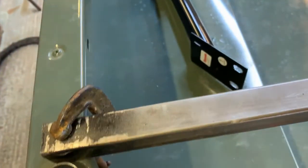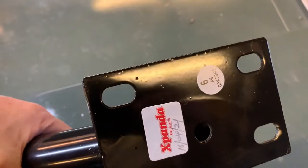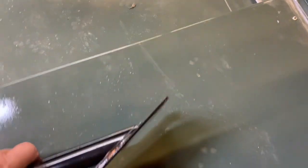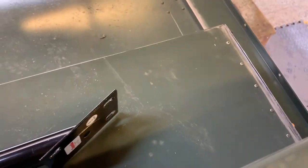And they've given us three welded on nuts, as you can see. Okay, 1, 2, 3, with 3 M10 bolts, and then 3 M10 bolts at the bottom into the aluminium plate, through the aluminium plate into a steel bracket on the back. I'm going to fit it as they want, and then I know I've got no worries with insurance or anything. So let's get this done, and then I'll come back and show you what I'm going to do.